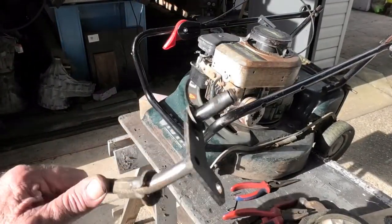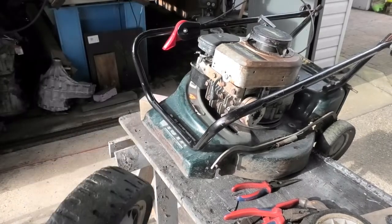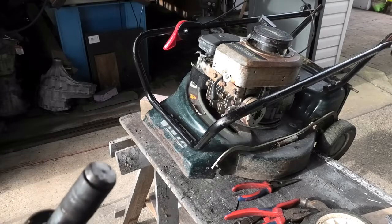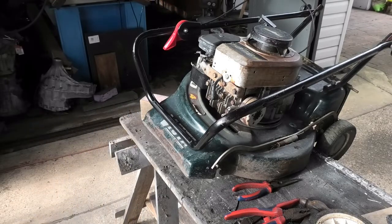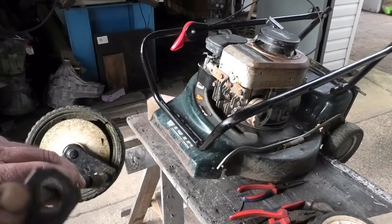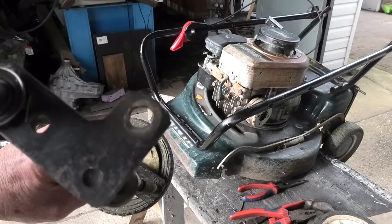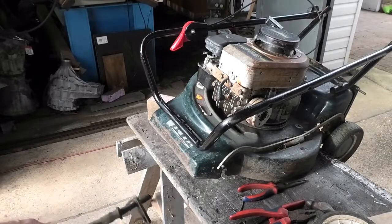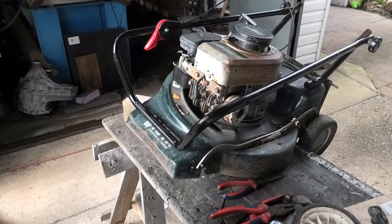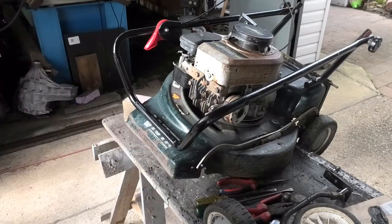Around here, the axle looks okay where the bushings run, and the stub axle is good. But that hole is no good. Have to weld that up and re-drill it. Got to get that arm off, transfer arm, and replace this pin. At least. Leave it with me.